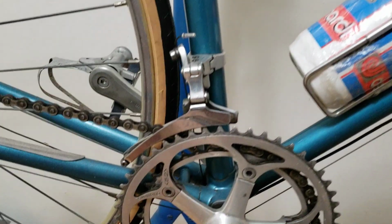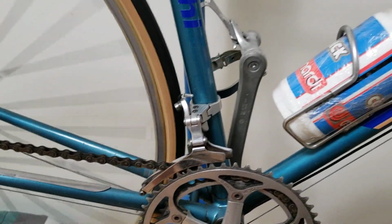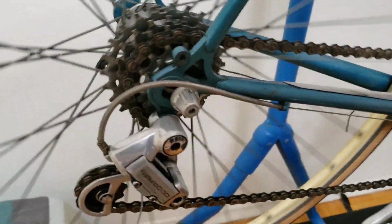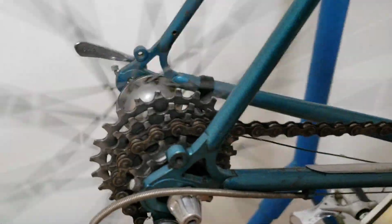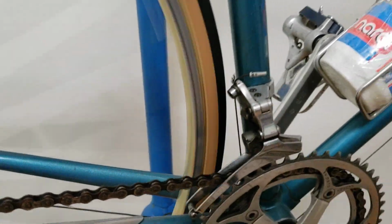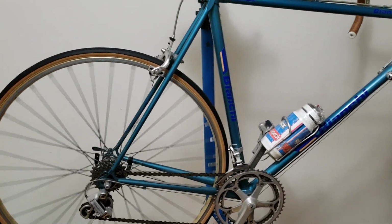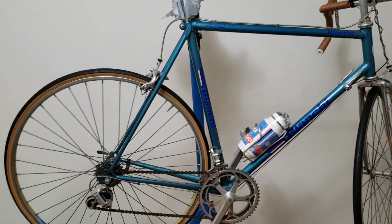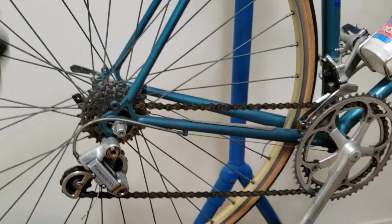And that's something there. Now, again, you're going to also come down and check your bottom bracket. Usually this thing can get a little loose, so you want to make sure your bottom bracket is tight. And then again, you want to check your gearing, and you want to make sure how this is working. So you want to make sure, again, see, you're going to change the gear. So that's pretty good. The one at the front, you want to make sure it's going to operate, and that's pretty much that. So this will be my very formal tutorial on how to check your bike and whatnot. And again, here at the back, you also want to measure the chain sometimes. And that's pretty much that.